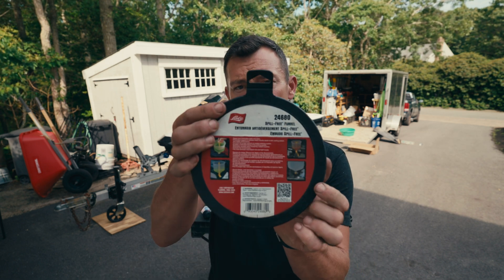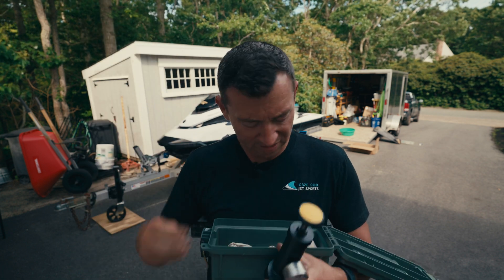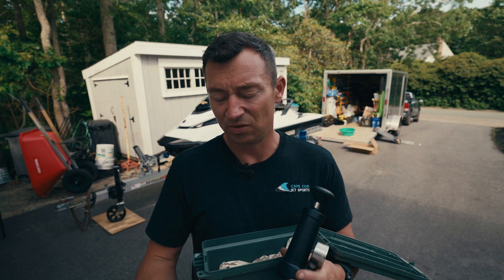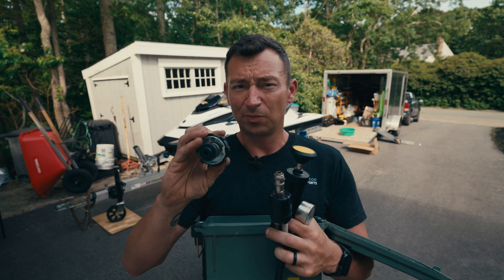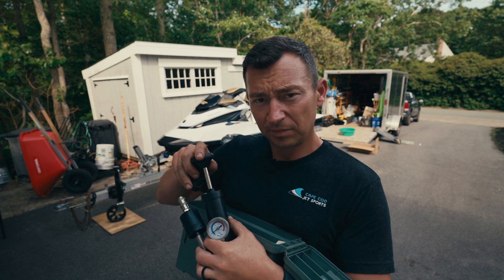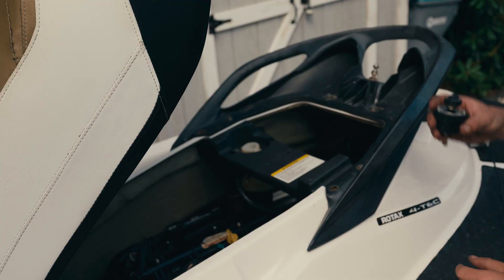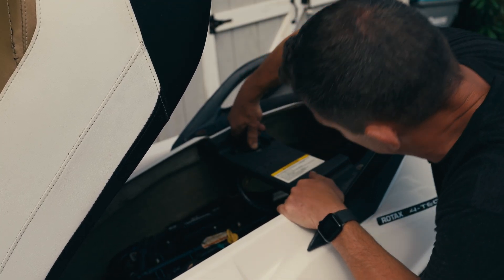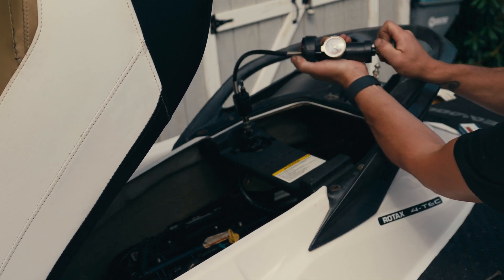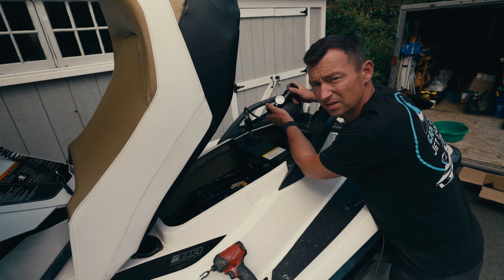This is what I use before I put coolant in — if there is a leak, I don't want to waste coolant. This stuff is kind of nasty and you don't want to clean it up. I got a tool where I can put it in place of the cap, pump it up, and see if it's holding pressure before we put any antifreeze in. It's all set — it's not leaking.